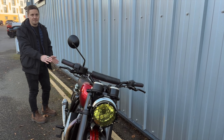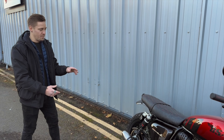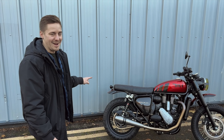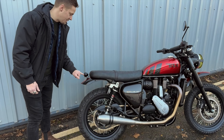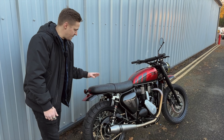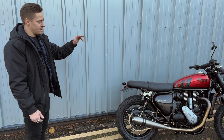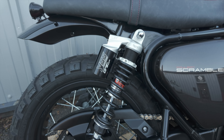We've used the original factory mudguards but we've cut them short — there are two reasons for that. One, we don't have to make new parts when the factory has already spent a lot of money making a part. Two, they actually cover significant areas of the motorcycle. For example, the rear mudguard — if you just made a short steel one, all the stuff off the rear tyre would go right into the electrics. So we used the original one so it covers everything safely but still has that short look. We've gone with a brat-style rear light with scrambler styling. There's some clever wiring trickery required because of the CAN bus system. On this model we've gone with tiny MotoGadget 3-in-1s — three running lights, three brake lights, and indicators on the back.